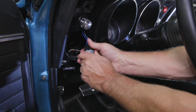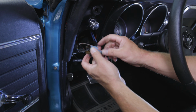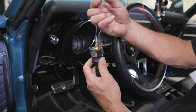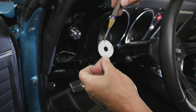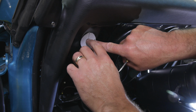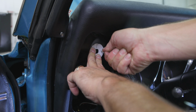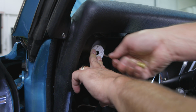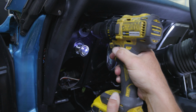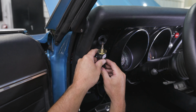Remove the wiper switch connector and tie up the original wiring under the dash if desired. Remove the hex nut and star washer from the DSE wiper switch. Cut out the provided switch mounting template from the instructions and place it over the existing wiper switch hole in the dash. Make sure the arrow is pointed up at the 12 o'clock position. Mark the center of the unshaded circle on the template onto the dash at the 3 o'clock position. Remove the template and drill a 5/32 hole in the dash to accommodate the anti-rotation tab on the DSE switch.